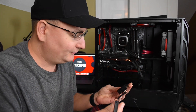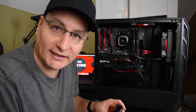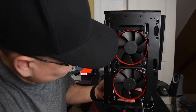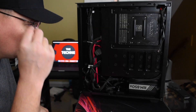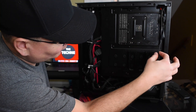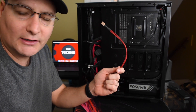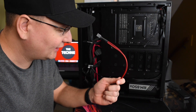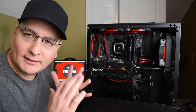Now getting into the installation — this seems super easy. You've got a SATA cord, you find somewhere it fits, plug in your fans, and you're done. What we ran into though is that the rear exhaust fan cable doesn't quite reach — it's just falling short. Luckily I had some extenders on hand, so I just plugged an extender in and brought it down into the hub. Make sure you order some extenders if needed — they're extremely cheap, like five bucks or even cheaper if you don't get the colored ones.